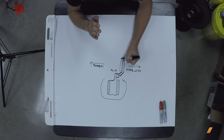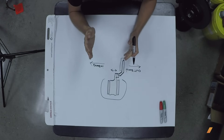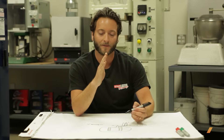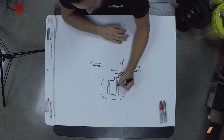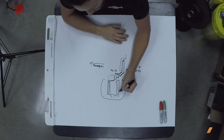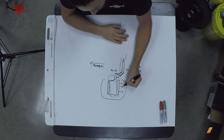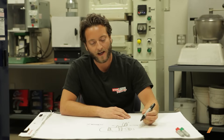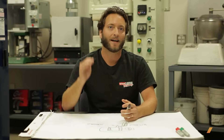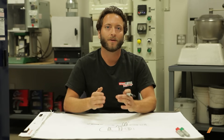As the car is turning, the rotor, hub assembly, and everything in the suspension is malleable — it moves under force and under heavy loads, ever so slightly. When the hub bearing and the whole hub assembly moves, it clocks the rotor like this — an exaggerated outline. This pushes back on the pad and pushes the piston back into the caliper, so the next time you apply the brakes, you get massive pedal displacement and feel like you don't have brakes and have to pump it to get brake pressure back. That's what axial float helps with.